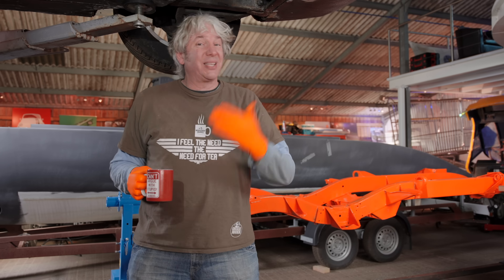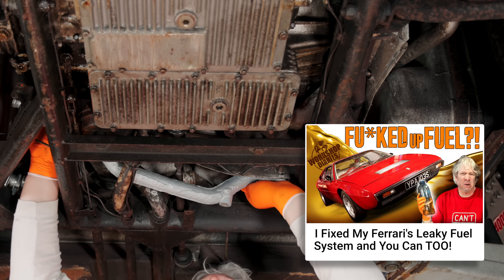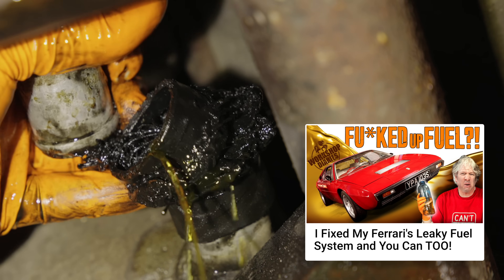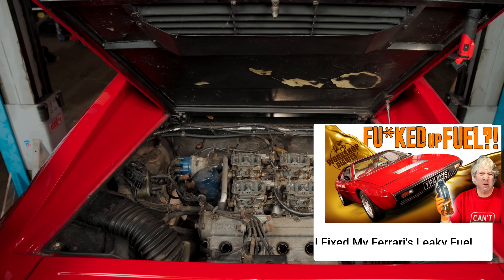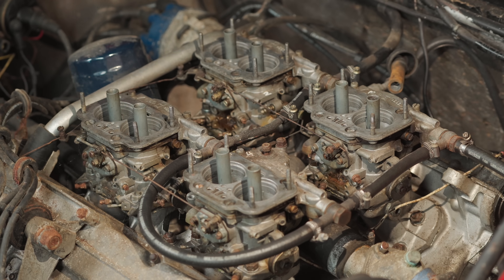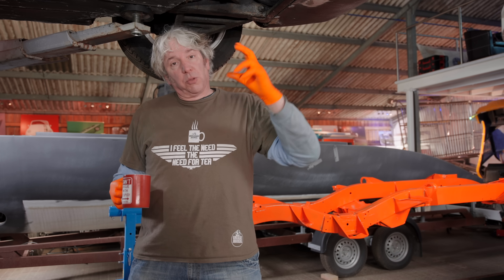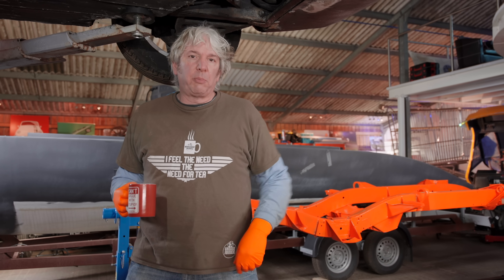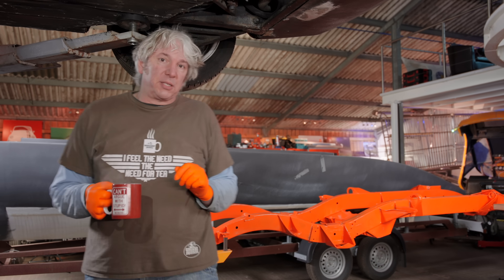We still don't know if the engine runs, and that's what we've been working on in our second video so far. We've kind of reconditioned the fuel system, got it so it doesn't leak anymore, and hopefully it's less gummy than it used to be. A video coming up in a week or two is when we actually do the rest of the service work — timing belts, the seized water pump, spark plugs, and a compression test.